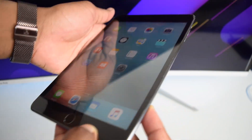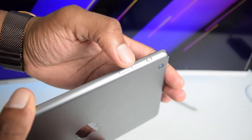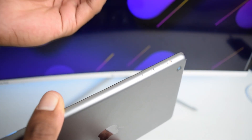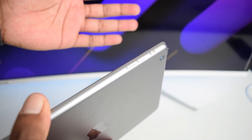If you've got a more recent iPad without a physical home button, you'll need to perform something a bit different: tap volume up, then tap volume down, then press and hold the power button for a couple of seconds. This needs to be done rapidly — one, two — and then press and hold the power button for six to seven seconds until you see the Apple logo on your screen.